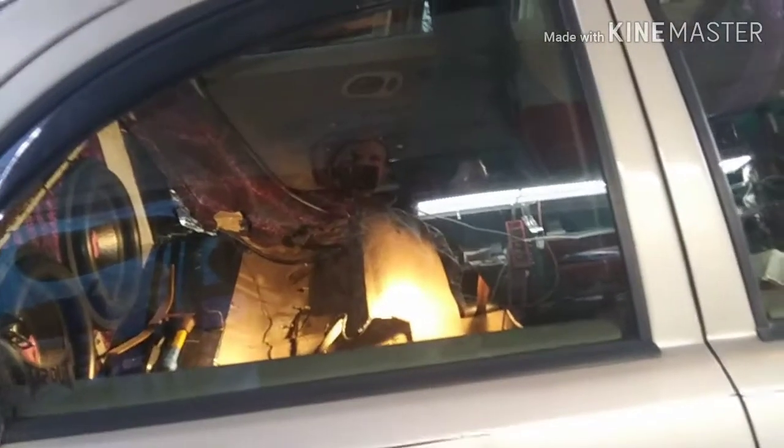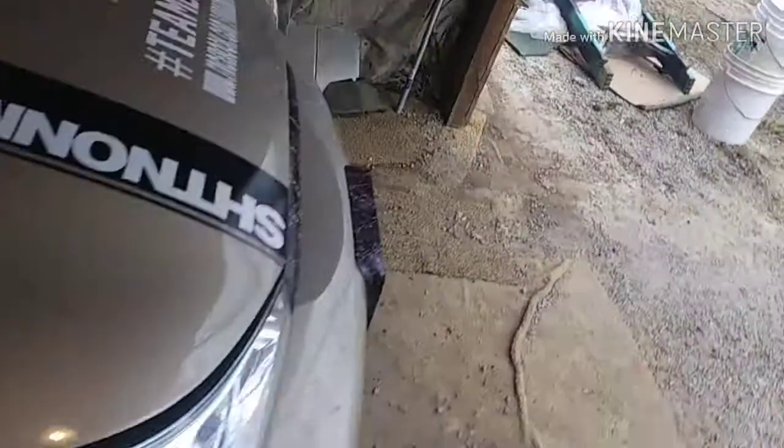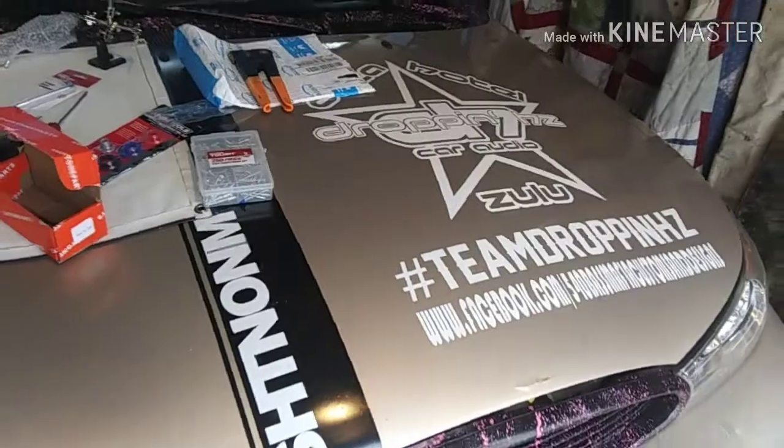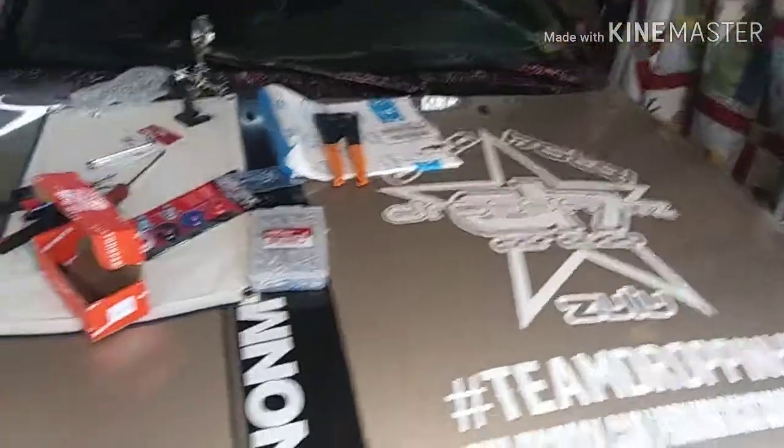But yeah, the fuel pump's installed. Let me clean everything up. We gotta run to town. I'm gonna get some different oil. Just change the oil in the car, but for some reason I think the oil is actually too thick right now for our liking, because it's just not getting up to the lifters fast enough when you start it, and it takes a while. Once the oil gets hot, it lubricates everything a little bit better, and they don't sound quite as loud. But if you run just, say, straight 30 weight in it, that's usually the best. So that's probably what I'll go and get.